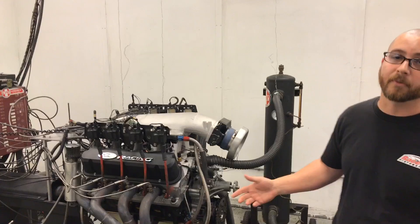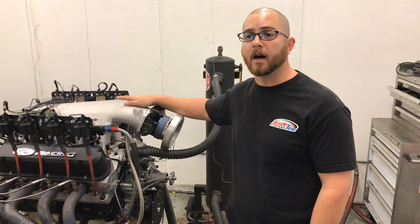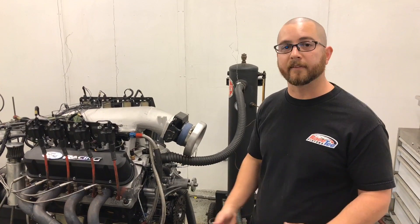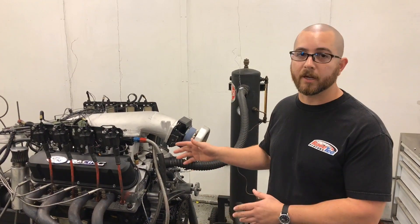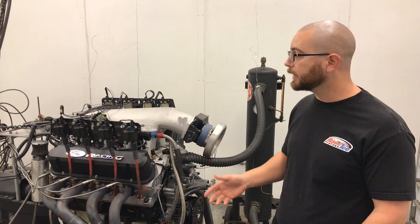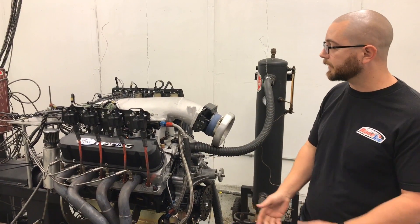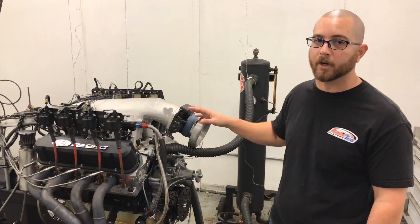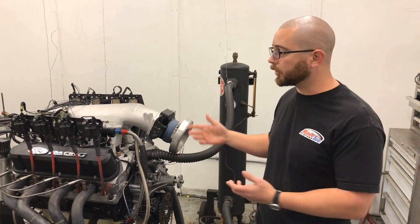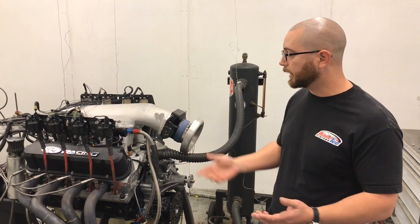The main purpose of this video is to test different intakes, because although a lot of people have seen the Holley Hi-Ram on engines, on engine stands, or on Holley's website, there haven't been a lot of videos for guys that want to use it. We wish we had a bigger engine, but this 408 cubic inch at 10.5 to 1 compression should work pretty well even with this big Holley Hi-Ram. Both intakes have been ported to port match and align with the heads. I don't see the point to running an intake if you don't at least port match it — you spend all this money on bigger heads and don't spend the time to port match it, it's like you're working backwards.